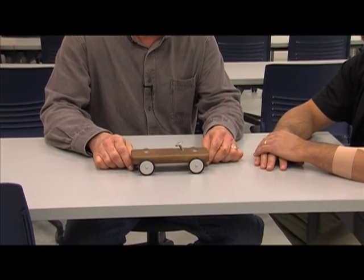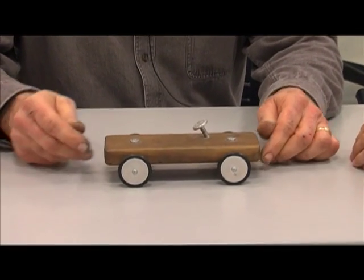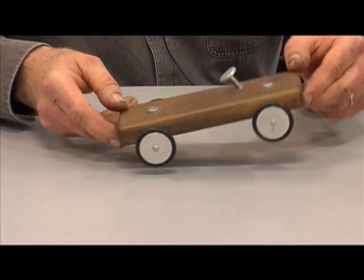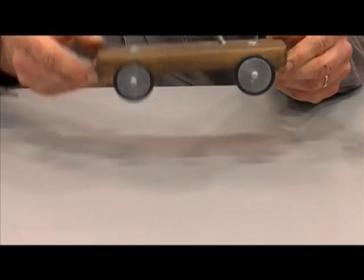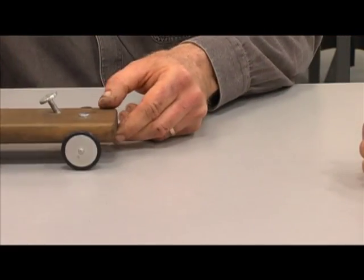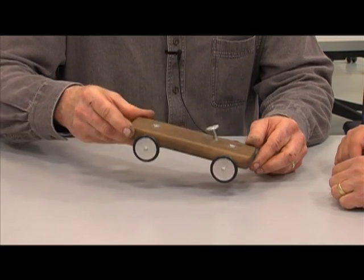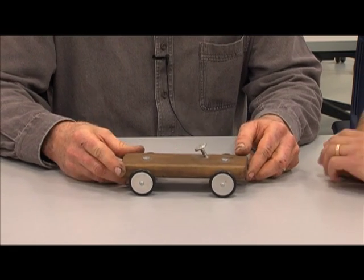I mean, the car actually begins to. It has a roll. It has some yaw. It rolls around the longitudinal and the lateral axis, as well as it's akin to porpoising. And if you've ever pulled a race car trailer or a trailer, you'll get in a situation where the vehicle and the trailer oscillate, and it's like a porpoise in and out of the water, and you feel like you're doing that going down the road. Right. So swarping has some of the characteristics of the porpoising, but it also has the chatter and the brake hop.